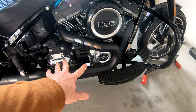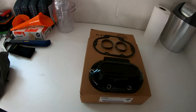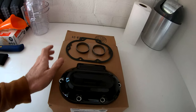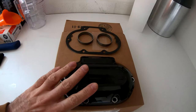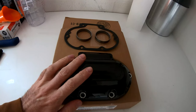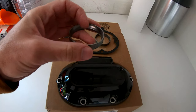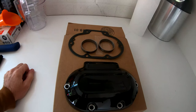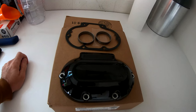These are the two parts we're going to be swapping out, but in today's video we're just doing the transmission cover, right here. We have a genuine Harley-Davidson transmission cover and a gasket. I'm not sure if you need to replace the gasket every time, but I'm not going to take any chances — I'll put the prices up of everything it cost me. I think the gasket was about $20 odd dollars. And these are two gaskets for the header pipe, where the header pipe joins the motor. It's got a thin side and a thick side, and by all accounts it just fits in one way and sits very snugly. They're about $12.50 to $15 each — for the sake of $30 you're definitely going to want to replace them as well; you don't want any exhaust leak.